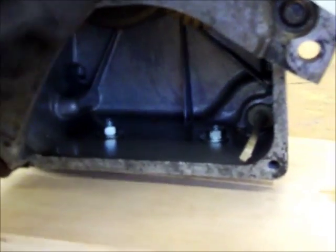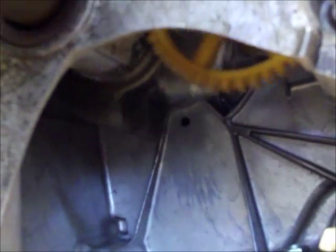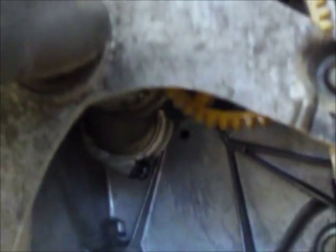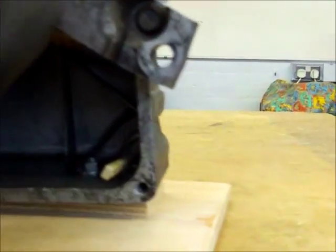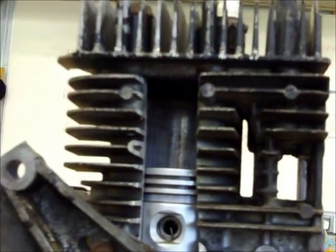This is the crankcase here, and you can see the actual crankshaft turning over there. There's the piston coming down, and there's the crankshaft. Now, this engine is lubricated by a store of oil that's kept in here, which is called the sump, and on this very crude basic engine, it's just really thrown around the engine to lubricate the cams and the walls of the cylinder.